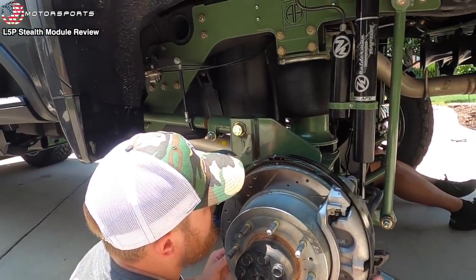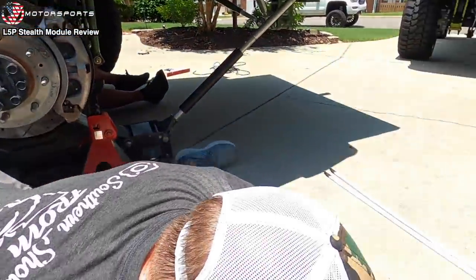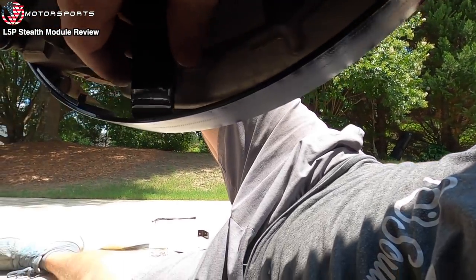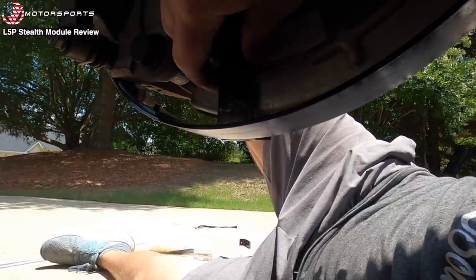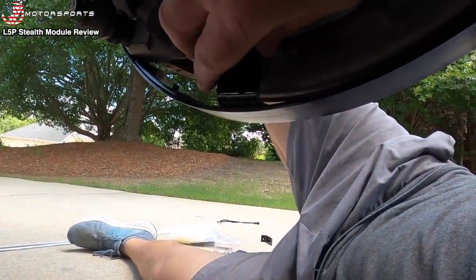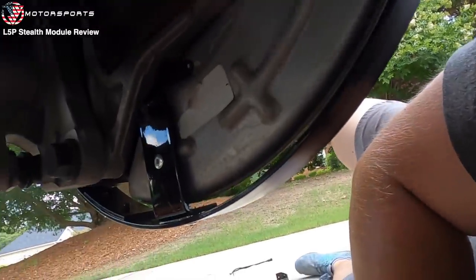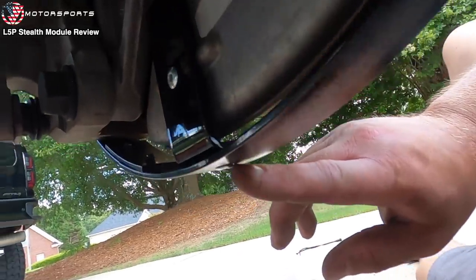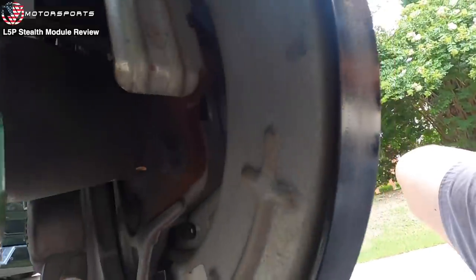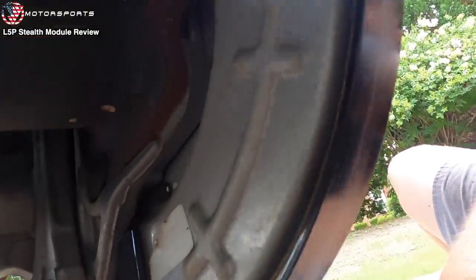So the first bracket's on — it's going to have a little bit of wiggle. You don't want it completely touching the caliper or the other side, so center it the best you can. On the underside you get the bracket, set it where you want it on the dust shield, push it out, drill the hole through the ring matching the hole on your bracket, then mount the bracket with the supplied bolt, nut, and lock washer to the ring, then do it to the dust shield. The third bracket goes right here — one top, one bottom, and one on this side; the opposite side will be your caliper. Those three mounting points are your anchor points.